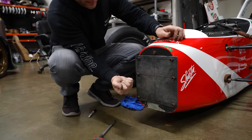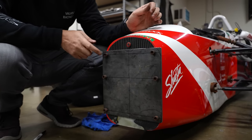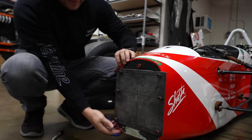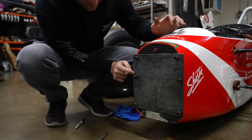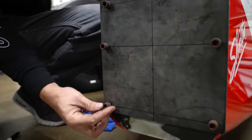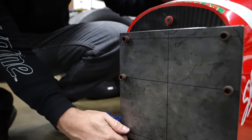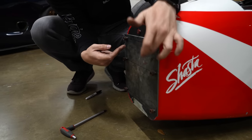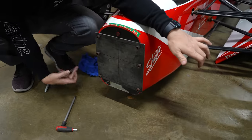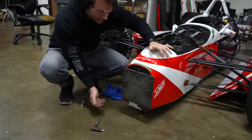That is the plate all the way onto the car. These bolts have a little bit of a shoulder meant for the front nose, so we'll make sure we have spacers for that as well. That's nice and on there. With the drill I nailed them pretty solid, and then I had to give a little bit of tolerance for these here — but they're well within the bolt head, so it'll be evenly supported. We'll also make a large hanger shape — triangulated here and here — so we have a jacking point and jack stand points.